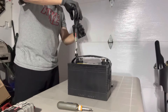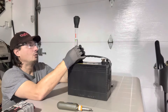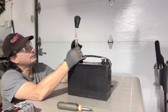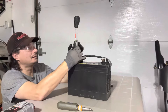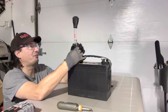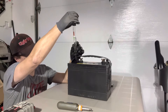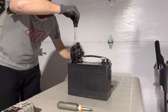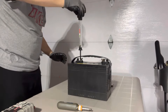My float just floated. I'm still in the green but I'm about to cross to the white, so this cell is showing signs of fatigue. We put the liquid back by pressing the bulb and releasing it back in. Now I'm going to go measure cell two.